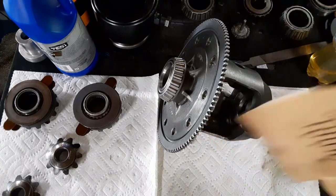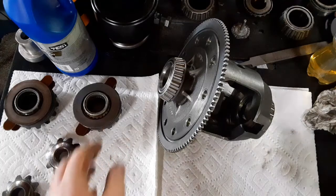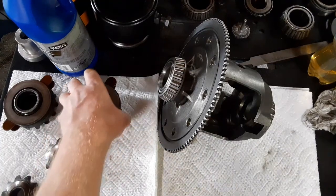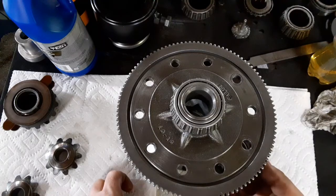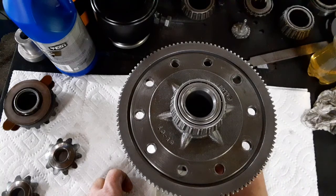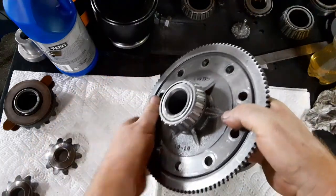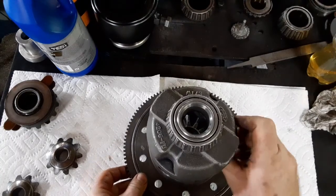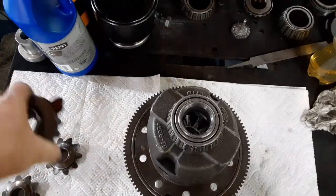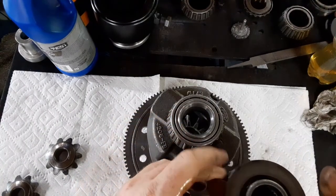So I've got my stack-ups together, everything is lubricated. We'll slide all this together - just slide it in and lift it straight up into position. You'll feel it go in, then flip it over. When you're sliding it in, you just want to wiggle it just a little bit to line up the clutch ears.